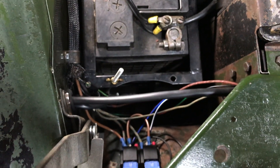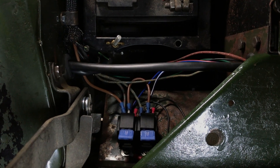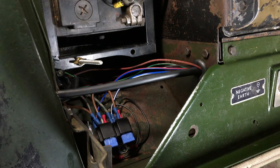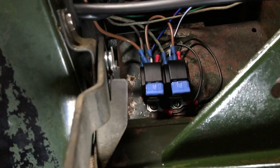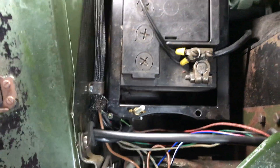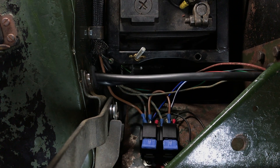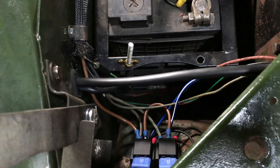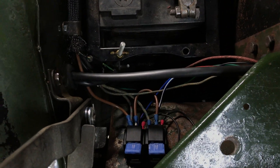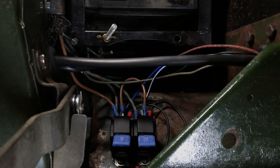Lighting's not very good tonight because I own the garage. Those two cables coming off the battery up to the dash are for electric heaters - need a proper heater at some point, but they might be useful in the winter. That's where I've put my relays. I don't think that small amount of wiring is going to get in my way, and I don't think the relays will be in my way either. The horn is going to go back on here, and I can get the battery tray and retainer tray in and out no problem. It's good to have them as near the headlamps as possible. Most of this job is actually tidying up wiring and getting everything neat and taped away, but we're done now - on to the next job.